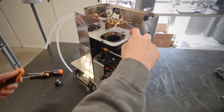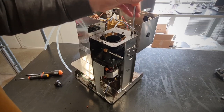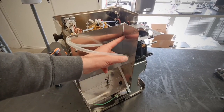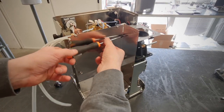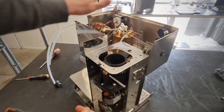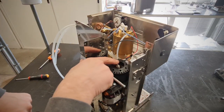As we can see, we have two screws — one here and one here. Remove this screw with the cross screwdriver, then remove this with the T20 Torx screwdriver. Now as we can see, we can remove this — this is the reduction for the grinder. We have to remove it, and here we can see the burrs.